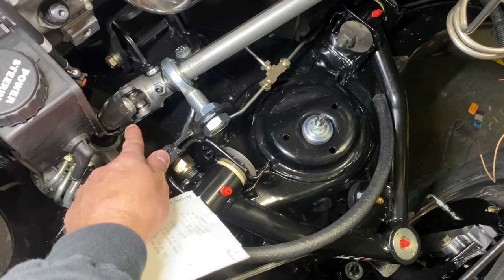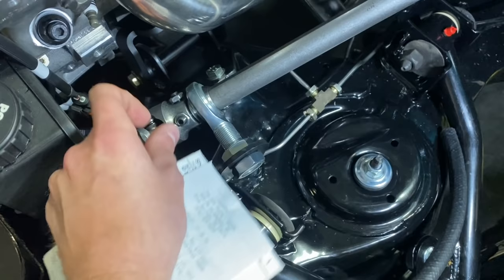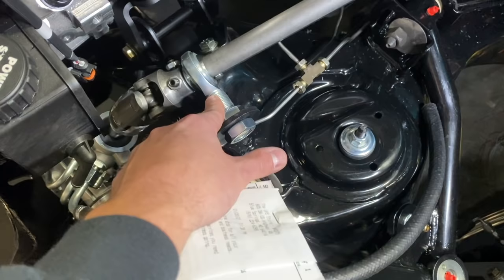They sent this brace. This basically braces it because you got this two-piece knuckle right here, and it'd move around without this brace. This was made to go over the stock size shaft. Obviously, this new one we got is bigger, but at the end here, it went down into the smaller size to go in this. So we had just enough room in there to get the Heim joint around there, and look at that. Spins perfect.